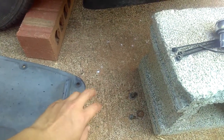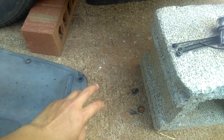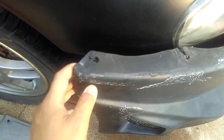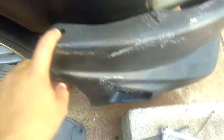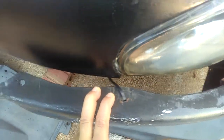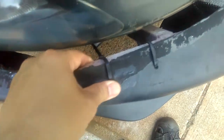When I took it out, it was on. But after I take it out and install it back on, it won't go back on. So right now I have to use zip ties. I zip-tied two already on this side and I need to zip-tie two more right here. Just use like an 8-inch zip tie through these bolt holes — through the body kit holes too, tied to this metal bar for the body kits. And it stays on well.